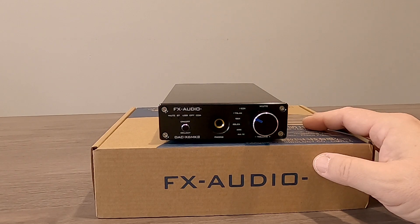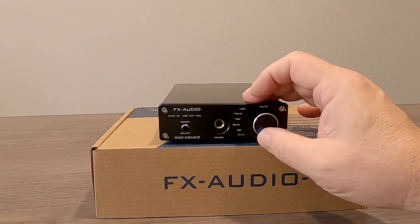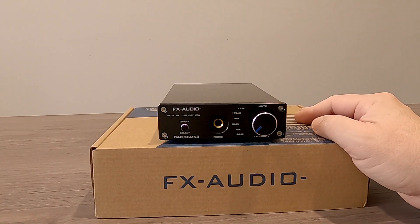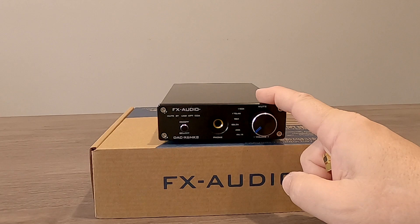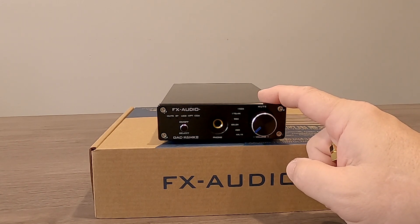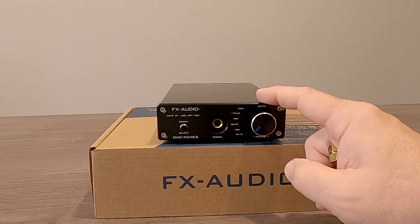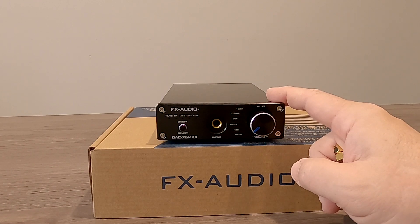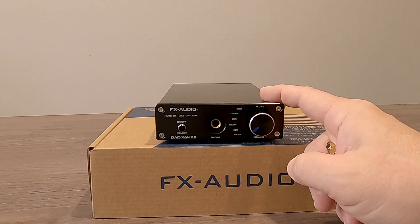This can be a really good upgrade. It does have a couple of things I don't like about it. I don't like this rotary encoder just continuously turning — that's why I have the marker on here. Also, spoiler alert, I'm going to have to send this back and exchange it on Amazon. The reason is this is Bluetooth 5.0 technology, yet I can only get about 9 or 10 feet of range with my cell phones — both my Apple phone and my Android phone and my laptop. These are not adjustable internally, so I'm hoping it's a component not to spec rather than a design flaw, and that's inhibiting the Bluetooth reception range.